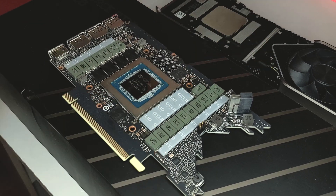So that was an interesting process, and it's all finished now. There was a slight issue and I actually had to pull the card back apart again. As soon as I installed it the first time and put a load on the GPU to check temperatures, our memory temperatures were looking pretty good in the low 80s, but our GPU hotspot was shooting right up to over 100°C, and our core went well up past what it was before. After some reading online, I found a lot of other people had the same issue. Even though the 2mm pads work on the die side, they do need to be squished down quite a bit to make sure there are no mounting issues with the die itself.